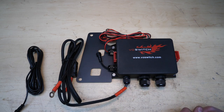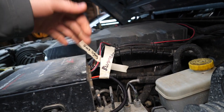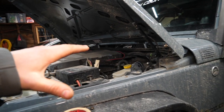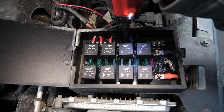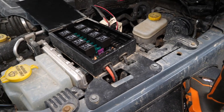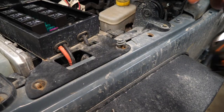First things first — before I pull out my old Voswitch system, I've labeled my leads: bumper light bar, rock lights, DRLs, and trail lights. Good idea to do that if you're going to be disconnecting existing auxiliary accessories. We're just going to pull this Voswitch open and unscrew these with a Phillips head — don't even have to fully remove them, just loosen and pull them out. All JK Voswitch systems are held in with two little 10-millimeter fasteners.